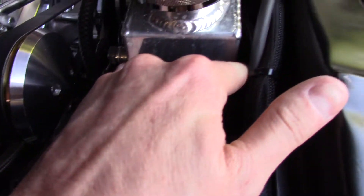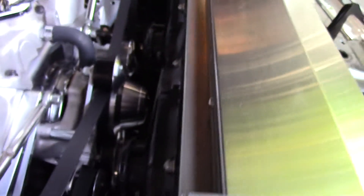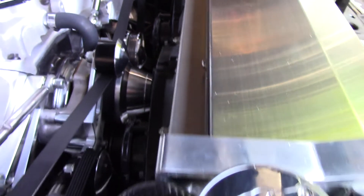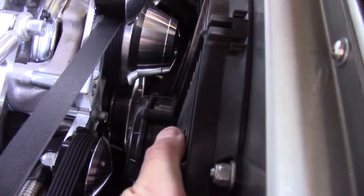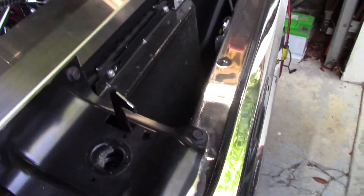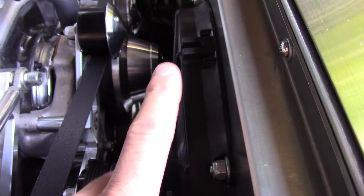This radiator I think is two and a half inches thick. We have a shroud in here too — that's also important. You're going to want a shroud, but there's more stuff that goes behind that; you've got to have reliefs in it for rolling down the highway. These are the high profile, high performance SPAL fans right here. These maintain a really good performance curve with a lot of resistance to flow. Because I've got my radiator here, I've got air conditioning here, I've got a trans cooler up here — all that starts to restrict flow to a certain extent. These are dual 13-inch high performance fans; I think the two of them together are about 3,500 CFM free flow rate.